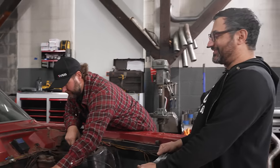Derek and Zach were installing the headers, and I went to turn the engine over to TDC so I could stab the distributor back in, and it just froze on me. We are thinking that the bolts of the flywheel are too long. It does not want to spin. And now we have to take the transmission back out. So headers are back down and out, and we're going to whip this thing out, adjust the length, and stick it back in.